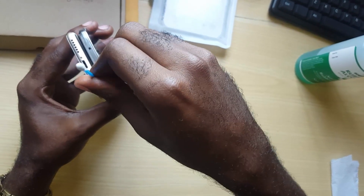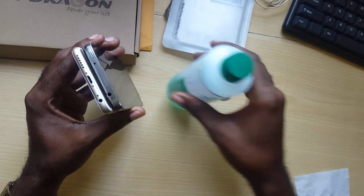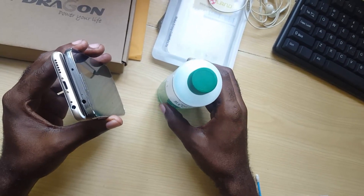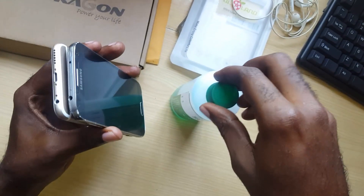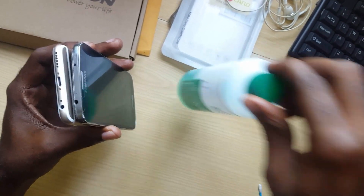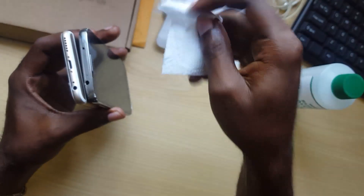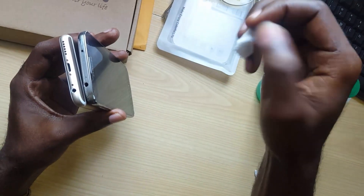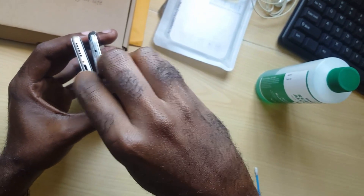On either device, you can turn on the music and as you clean, listen out for the volume coming back. You can also use rubbing alcohol or isopropyl alcohol — very pure, like 90% — which is non-conductive when pure and safe to use in the port. You can also use bathroom tissue, just fold it into a shape that will get into the port and remove the dirt and grime.